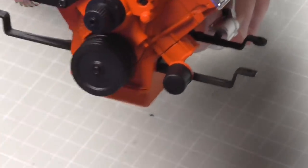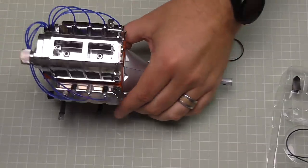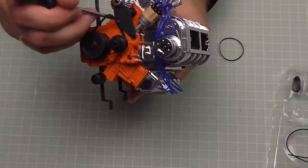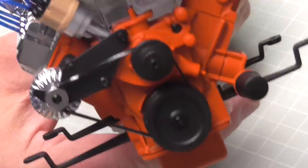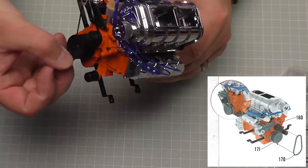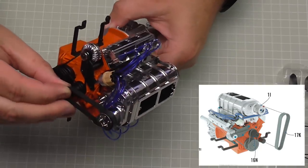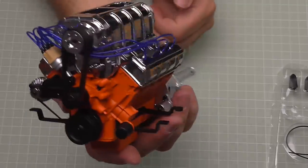The biggest belt — we've got two sizes here, a small one and a big one. The big one is going to go around the pulley of the alternator, around the inside ring of that one, and then this one is just going to go on the other side of the pulley — make sure it's flat and there's no twists in it. That's the first belt on. The next one's going to go into the second lead here, into the second one down the bottom. That's two belts on. Then we've got the really large belt which is going to go towards the supercharger and the belt underneath. That is all the belts in place.